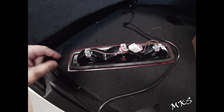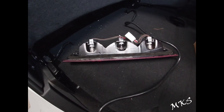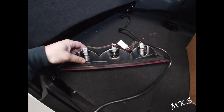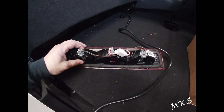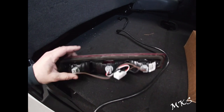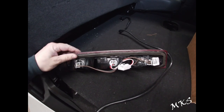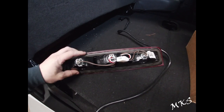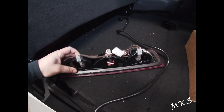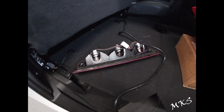So what we're going to do is use our 3M windshield adhesive. I called the dealership and asked what they use to seal this, because it looks like window adhesive. They told me flat out that according to FCA, the reseal procedure when they do these is to use what's called a Mopar windshield sealant. And when I looked it up, it's actually very similar to — or is the same thing as — this 3M window sealant that I have.